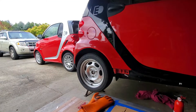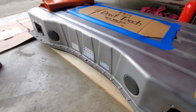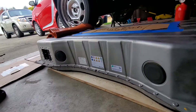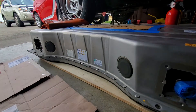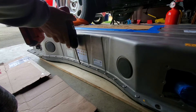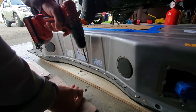Alright guys, we have this EV high voltage battery. You need to drill out two, four, six, eight, ten, twelve, fourteen rivets. Underneath there are some notches — all this yellow area. Right now we're going to deal with this riveting. It's easy to remove guys. This is aluminum.